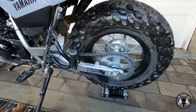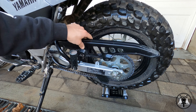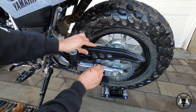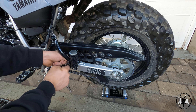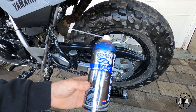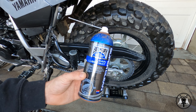After wiping down the lubricant, the chain looks good and the sprocket looks good. So I'm going to go ahead and reassemble the chain guard by pushing it back down into place and putting back the eight millimeter bolts. You don't want to go too crazy — this is just fastening the plastic to the metal. One thing I forgot to mention earlier is the chain lubricant that I use. This is just stuff from Bellray and it seems to work pretty good.